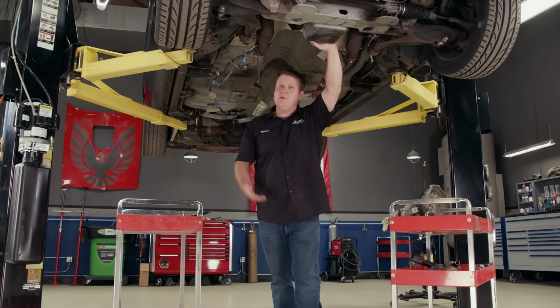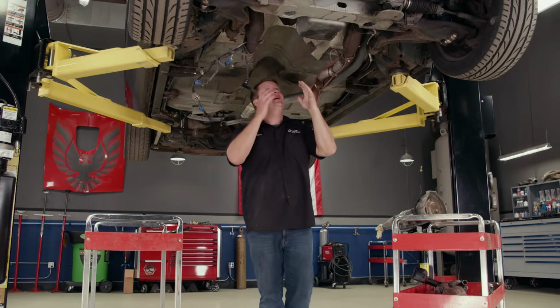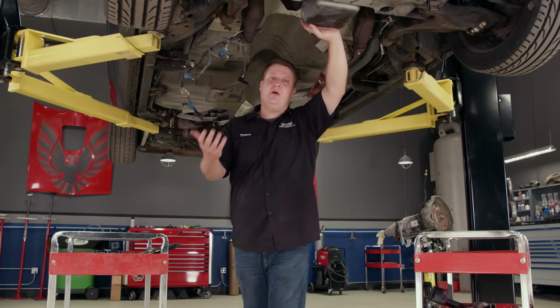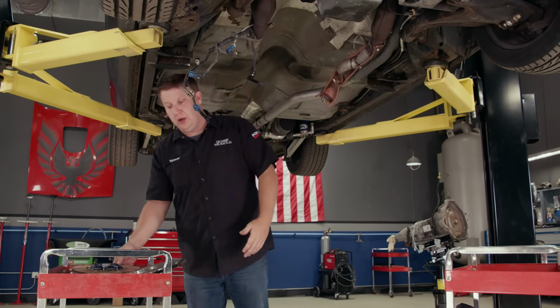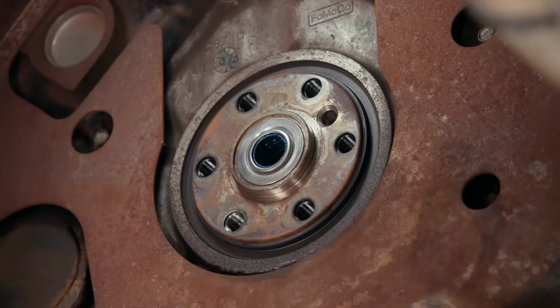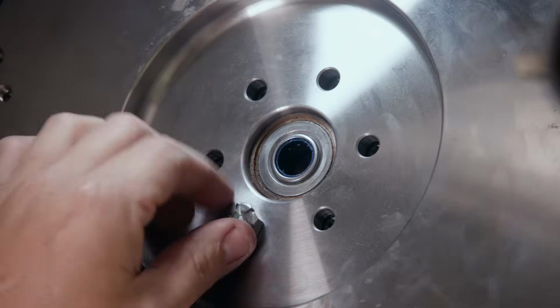this power plant and this Crown Vic is shared in the Mustang and in the pickup trucks. But it is handy to have somebody to help make your dreams happen, like what we're going with. So we went to American Powertrain for all the hard parts: flywheel, clutch disc, pressure plate, and so on. It's time for us to start putting some in. I'll knock in the new pilot bearing and set our flywheel into place, add some thread locker to the bolts, torque it to spec.